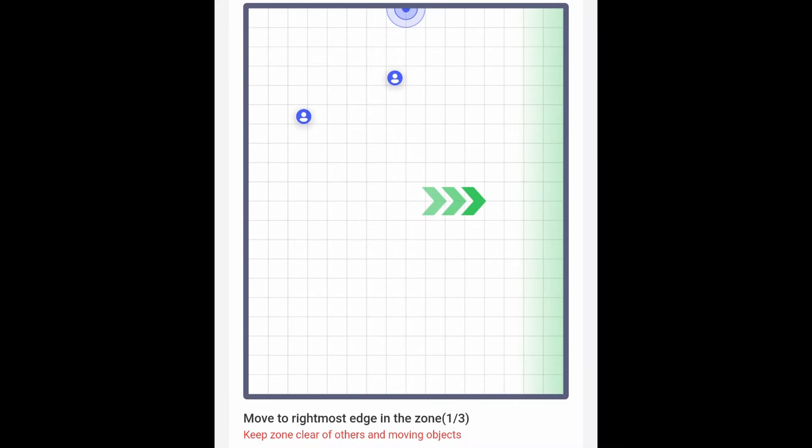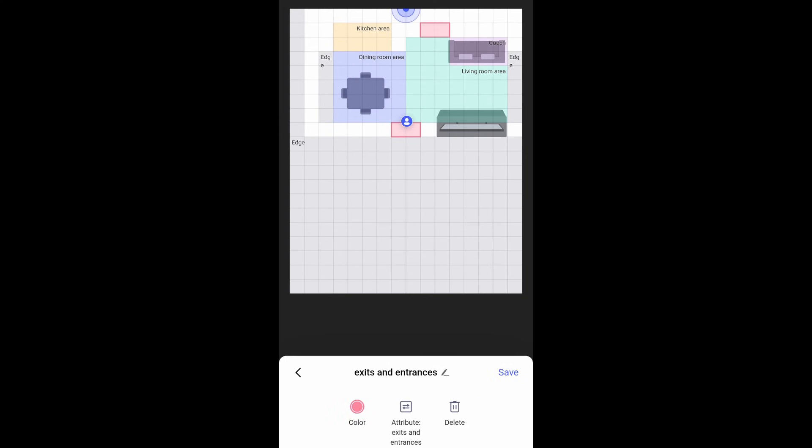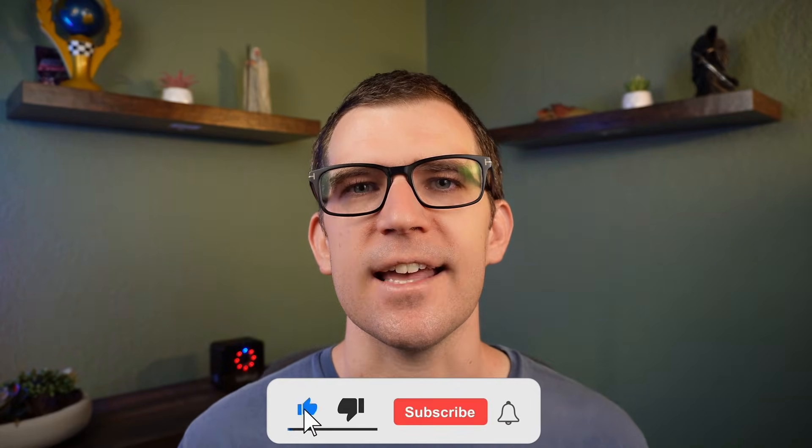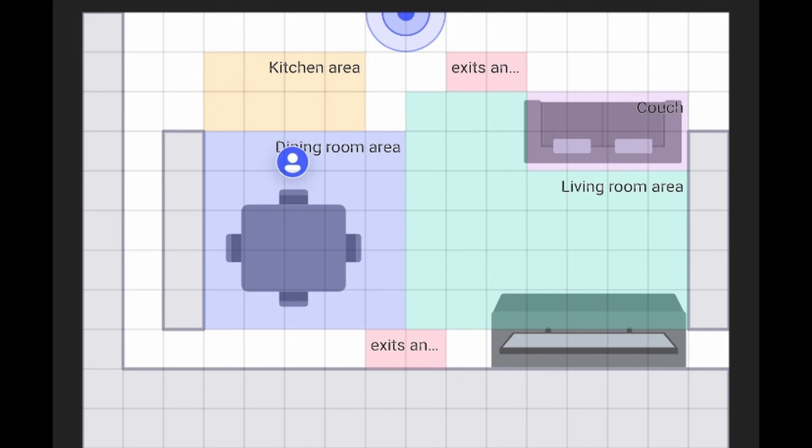When I was first setting up the FP2, I encountered ghosts. Even though I was the only one in the room, the sensor was detecting multiple people. It turns out this is a common problem with the FP2. This might be due to the fact that it uses millimeter wave, which is very sensitive — so when you walk around it knows you're moving, but a spinning ceiling fan or a dog walking by might also get detected. I was able to solve it by adding edge zones and enter and exit zones configured in the app. If you have a hallway or front door where you leave and enter the sensor's view, adding those zone types really helped the reliability of the presence detection.